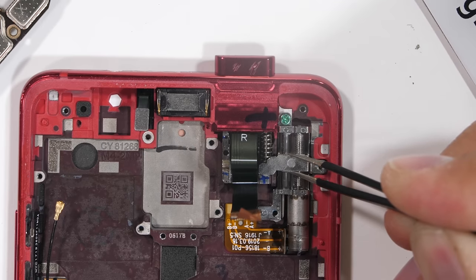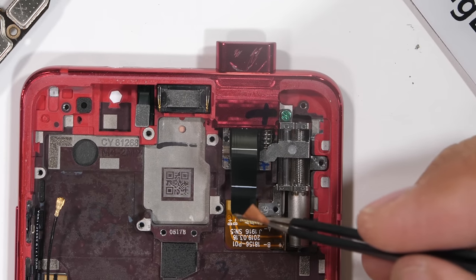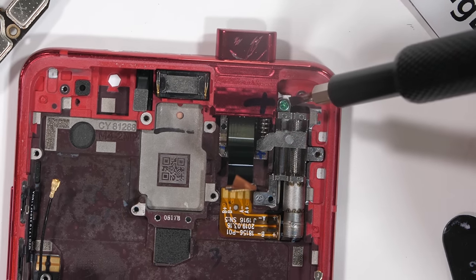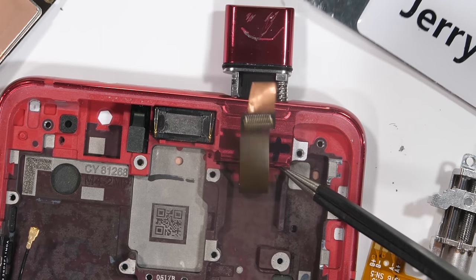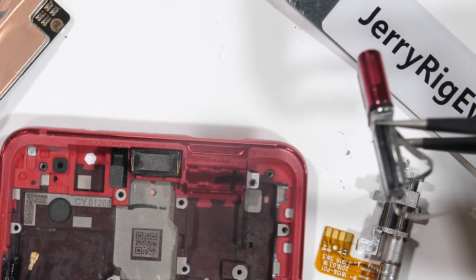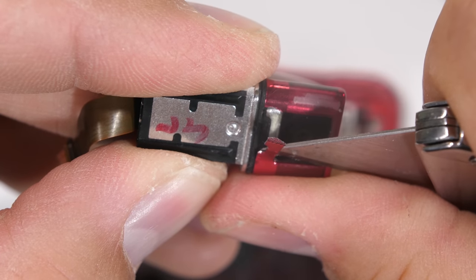Let's take a closer look at the light-up pop-up camera and see where that red frontal glow comes from. Surprisingly there is only one more screw left holding it in place — another green little guy. I'll remove that and then lift off the motor power ribbon and pull the stepper motor out. Then I can slide the pop-up camera up and out of the phone. Since there are no LEDs shining up into the lower portion of the housing, it means everything must be self-contained inside the boxy camera.